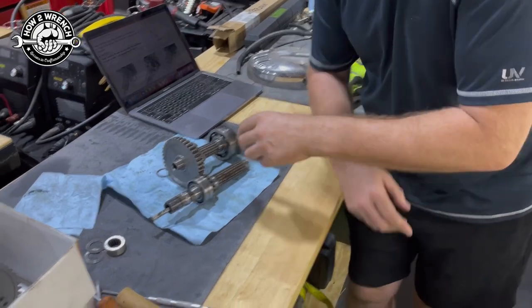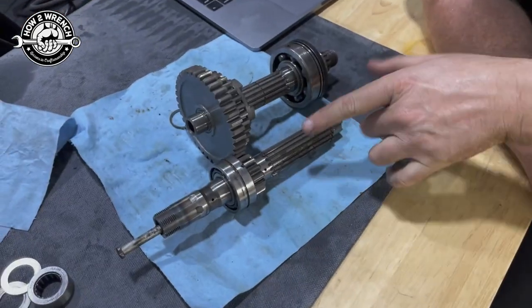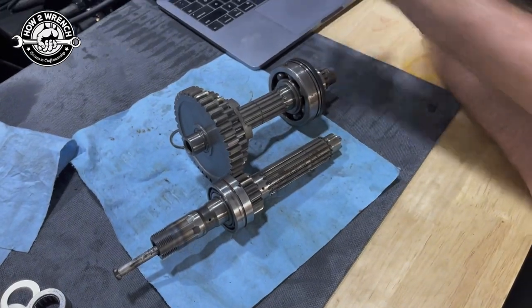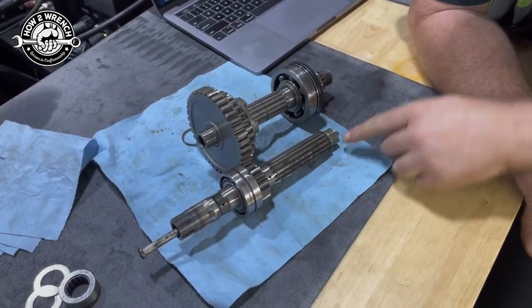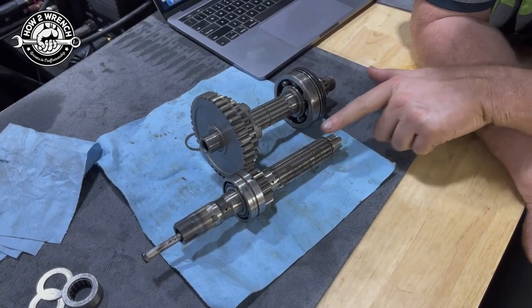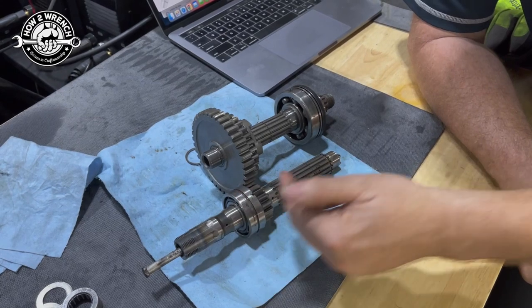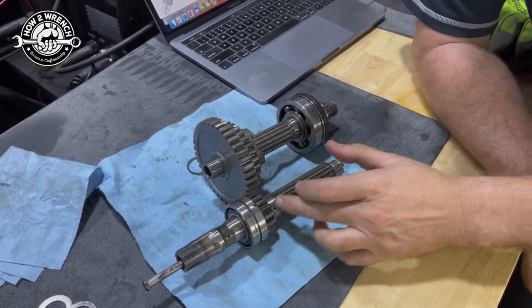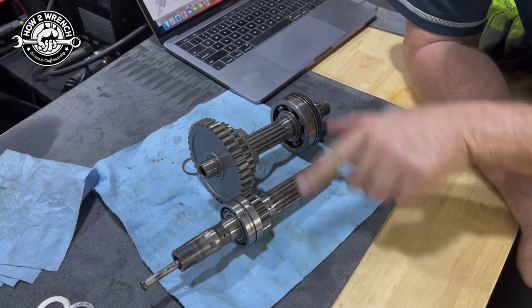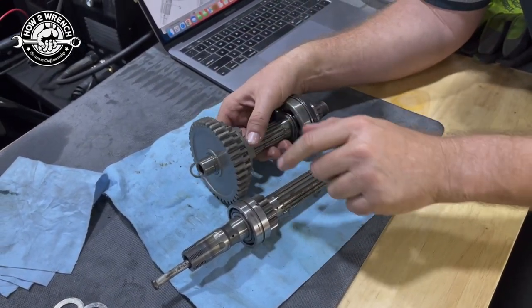Yeah. We could talk about that a little bit since we're in here. So, you know, in a previous video, we talked about the oil pathway, and you have to know how everything gets fed with oil, but it comes through the engine case. It feeds this side. It goes this way to get to this bearing. And then that's the end point. The problem is we got these little holes in here that are dumping oil for the shift forks and for those spinning gears that I talked about, like this one, okay? We need something to oil that.